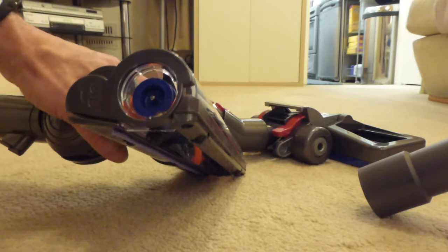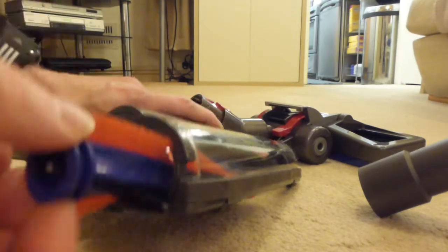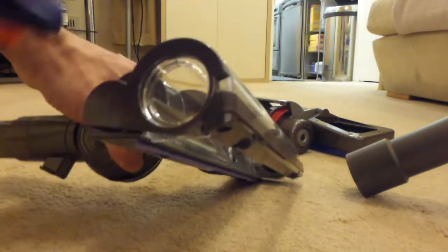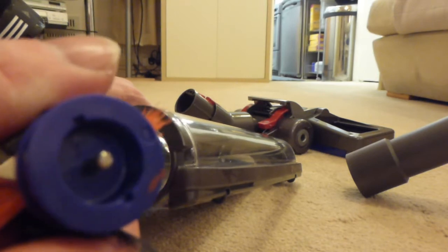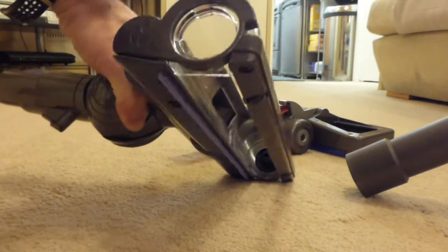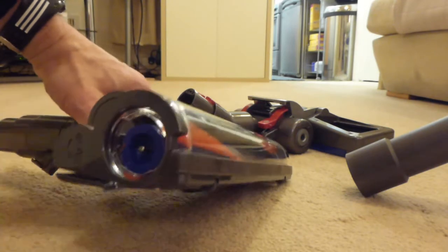The cover comes off, which is like the bearing cap. And then we can remove that from the head. There we go. So there's a little miniature brush roll, and that's removed quite nicely. So you can actually take that out now and remove all your tangled up hair from around it quite easily. And then I think what we would do is we would make sure that that's nearest to us, because that's the bearing, the spindle end, and the other end is just a hole. So that end is the one that goes in first. And push that back in, like so.